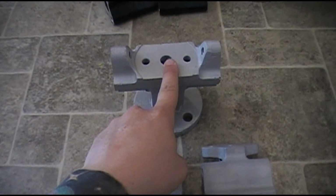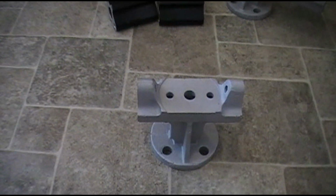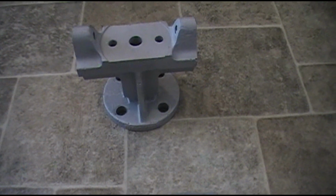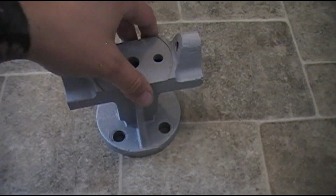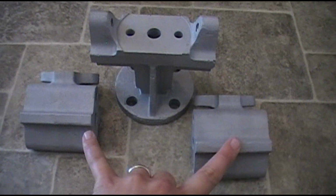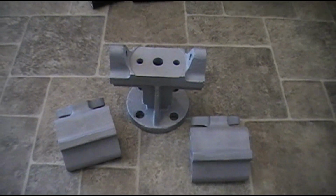I did see one instance where a gentleman was trying to sell just the low-profile 3-chime manifold, and he asked top dollar for it, claiming that, well, this came from a 3-piece manifold. Yes, that is true, but it didn't command a higher price because there's no difference between the low-profile 3-chime manifold and the one that was used in the low-profile 5-chime manifold. The only thing unique to the 5-chime manifold, the 3-piece, was the side extension wings. Those are the only valuable parts. Otherwise, this by itself is just a low-profile 3-chime manifold. Same exact piece, same part number and everything.